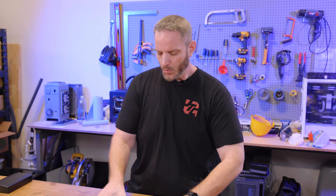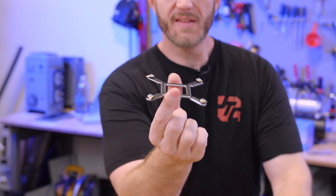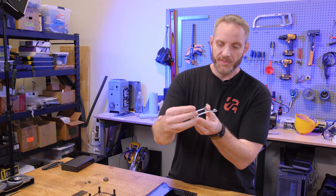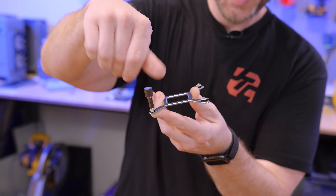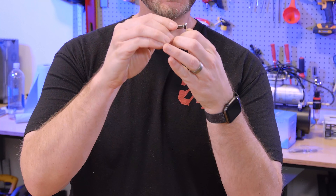The problem is a lot of cooler manufacturers took that and just made it wider, with a bracket that has adjustable slides on it. As long as they can match the width, they think everything's fine. The problem is with a typical Asetek retention system — it threads through the motherboard into a backplate, you thread it down until it stops, put the cooler on, thread the nut down until it stops. There are no springs — it just goes until the threads stop. That's fine with old sockets that had no Z-axis height change. But now that we have LGA 1700, which has a taller Z-axis height, cranking down a retention system like this — which a lot of manufacturers are shipping with their 1700-compatible coolers — is putting far too much tension on the CPU, causing an actual bow to happen with the CPU itself.